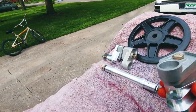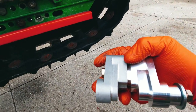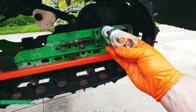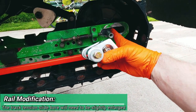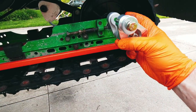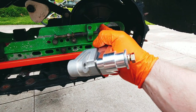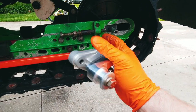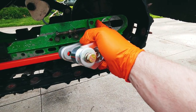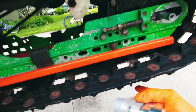So as you can see, what'll happen is you'll separate these two. You'll put them on the inside and it'll slip over this rail here, and one of these pieces will be on either side. This will allow the wheels to be forward, I would say probably 1.5 inches, and up about 3/4 of an inch higher. That way the track will sit even with the Hyfax.